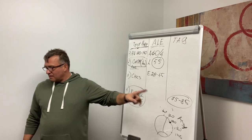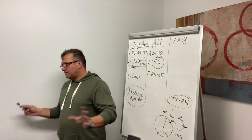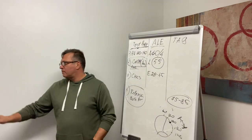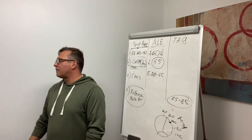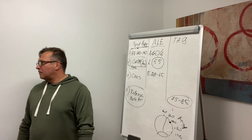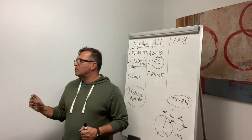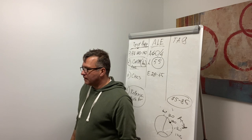Important. Be prepared to explain it. Sometimes they can ask, so why? You said it's 4, but it's not 4, it's 40. Because I'm losing 15 to 20 PSI when I'm pushing parking brakes, and I'm losing another 15 to 20 when I'm pushing the service brake. In fact, you need to check how many PSI your system is going to lose after you pushed your service brake pedal.